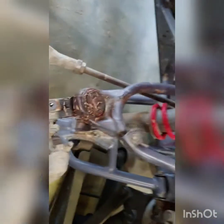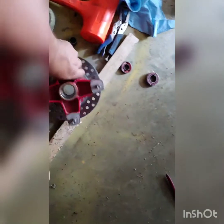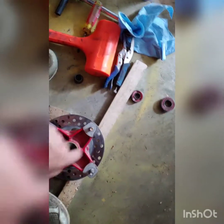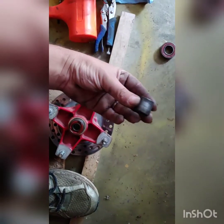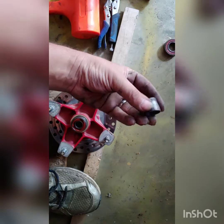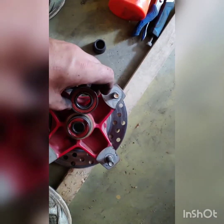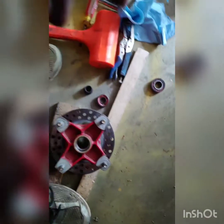I'm gonna get my brake caliper off real quick and knock the hub off, then I'll be back. Okay, I'm back. All you gotta do is get a punch — I had a punch — so I didn't smack the far out of my fingers. Go in through the center, one bearing, and then there's a spacer. The back bearing is bigger, so that side goes towards the back, this side goes towards the front because the front is smaller. Here's the back bearing next to the front bearing. Just knock it out.